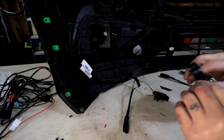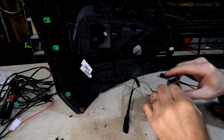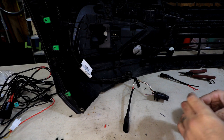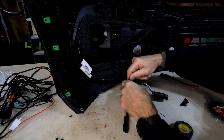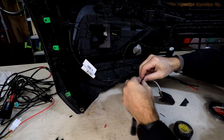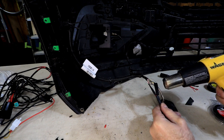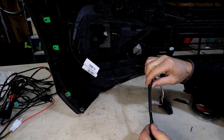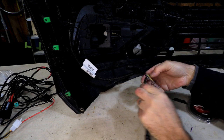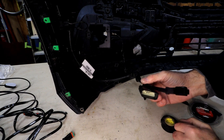I'm going to take some Super 33 Plus electrical tape and get a couple of short pieces for just a little extra security underneath the shrink tubing. I took an extra piece of shrink tubing, pulled it up as far as I could, and shrunk that on. Now I'm going to tape these wires together and then tape them all back as a bundle. I taped that all up, and I never did test it — so I hope this works.